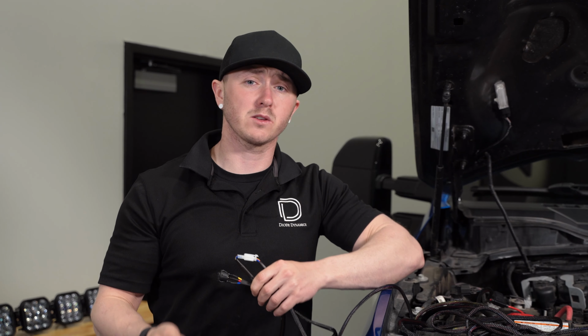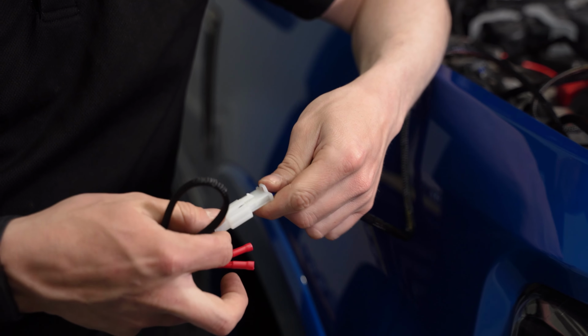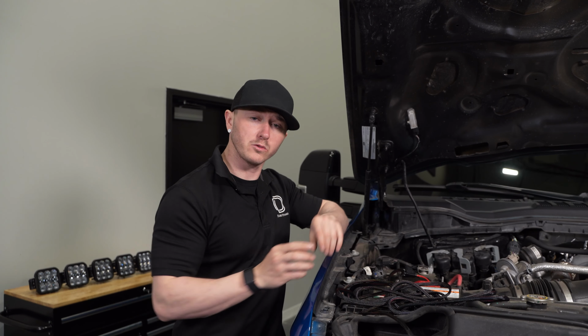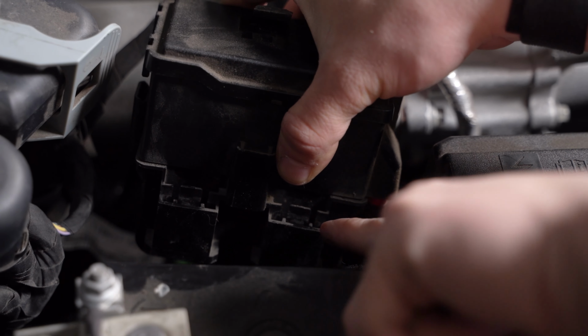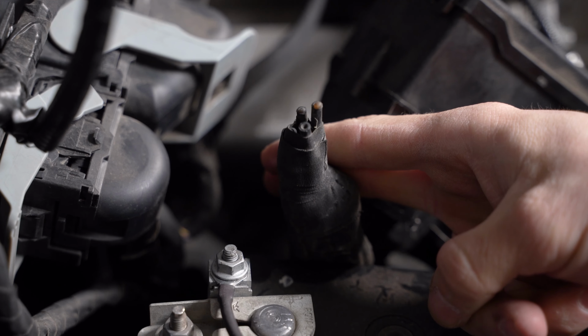If your vehicle has an auxiliary switch bank, you can disconnect the switch portion of our harness and connect our auxiliary leads. If you're connecting to the factory auxiliary wires, we'll need to press on the 2 tabs on the side of our fuse box and slide it off. From here, you'll notice a bundle of auxiliary leads just under it.